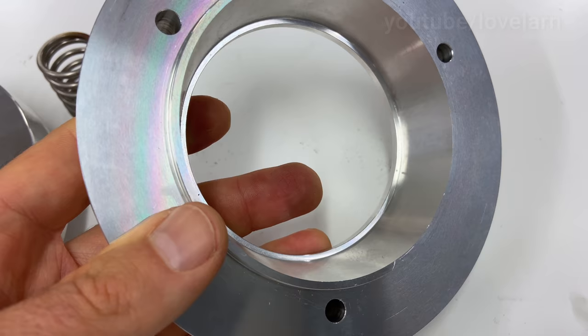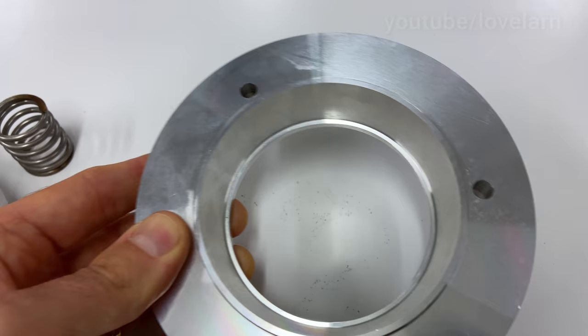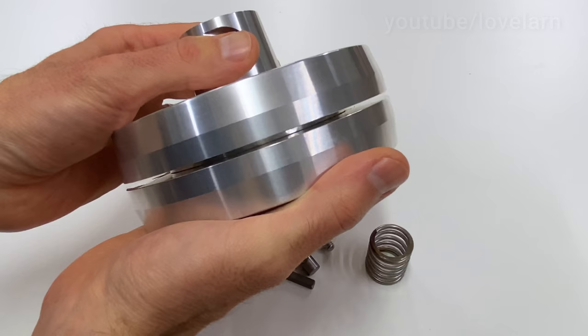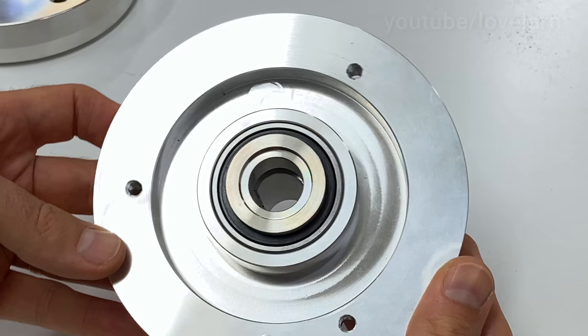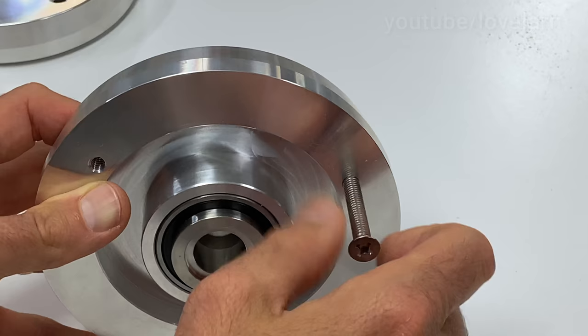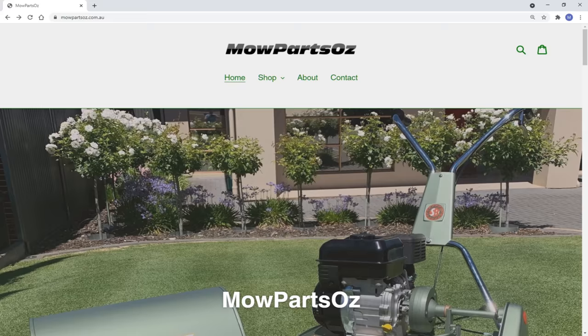The top hat is pressed into the bearing in the same way we're used to with the intermediate clutch. Other than its innate material beauty, the ringside clutch half is what we expect it to be — we've taken the cork out here and you can see it looks just like the original halves, complete with the outer lip. It's going to hurt a bit to smear contact cement all over that interface. When it comes time to put the two clutch halves together, you'll find another surprise testament to George's eye for detail: the holes for the three fastening screws on the engine side half are threaded. The stainless steel bolts pass through the ringside half and thread into and through the engine side half before washers and nylock nuts are installed on the other end — talk about a positive connection.